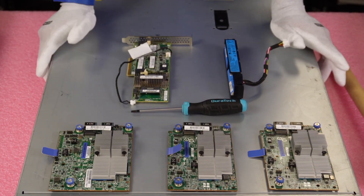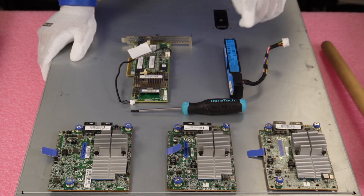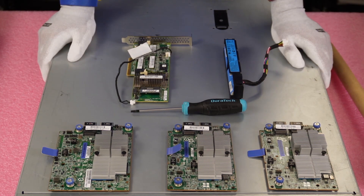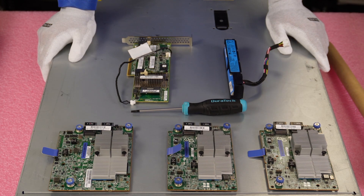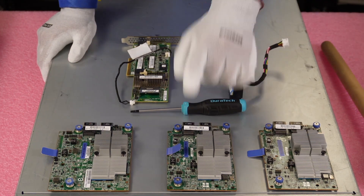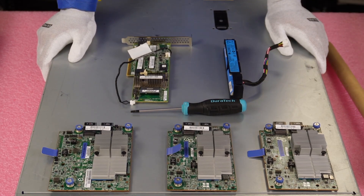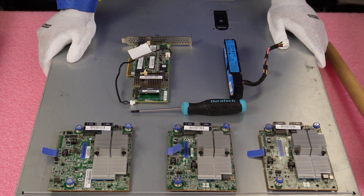With a 2U like this, you can just go with whatever's the cheapest option and get the same result either way. The other thing to point out is the battery. With Dell, for instance, the battery is built into the RAID card. With HP, that is not necessarily the case. So if you want to use the smart battery, you need to buy that separately. We'll show you where it's installed in the front. Make sure when buying your RAID controller that you get both pieces, because they are sold separately.